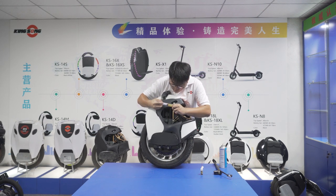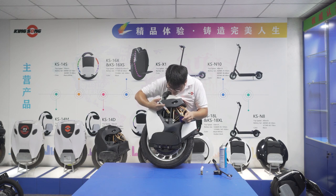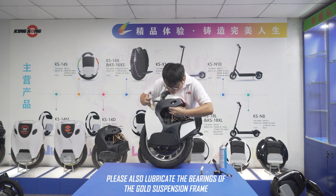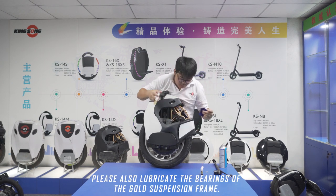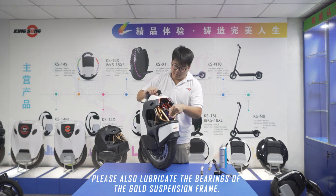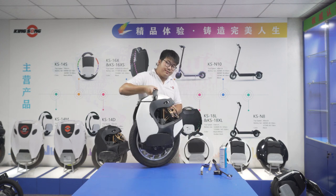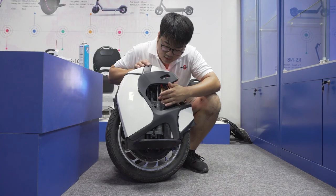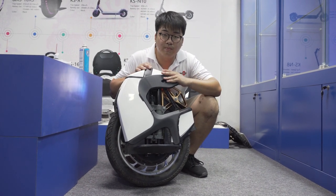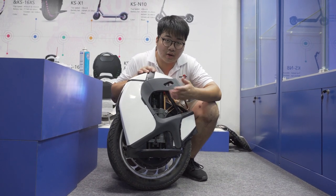Let me open this up so you can apply it. Do this for your four stanchions and your suspension on the back. After it's all lubricated, you'll want to bring the wheel down to protect the gaskets. Regularly clean them off, especially if you've taken this wheel off-roading — just take a microfiber cloth and clean off all the dirt and gunk.